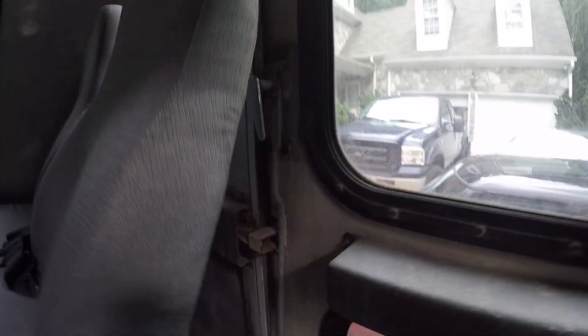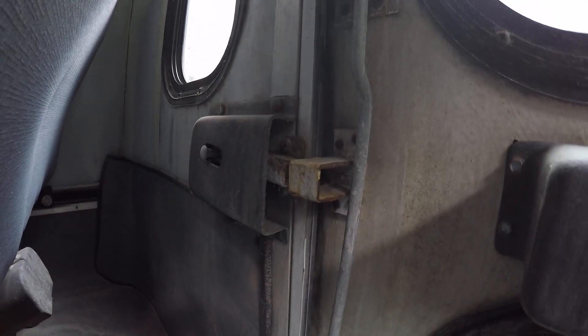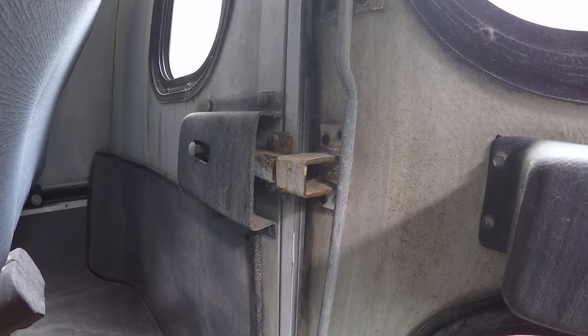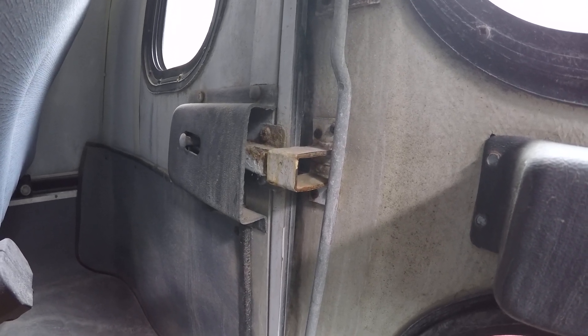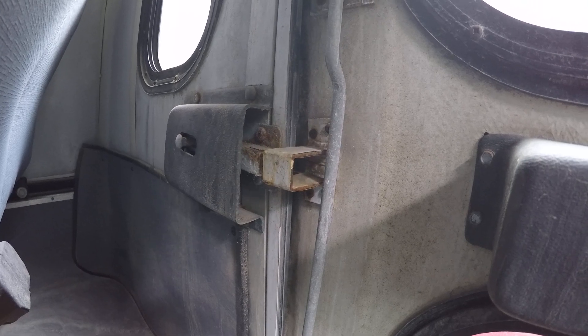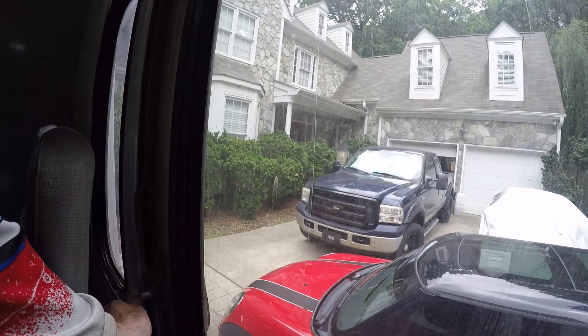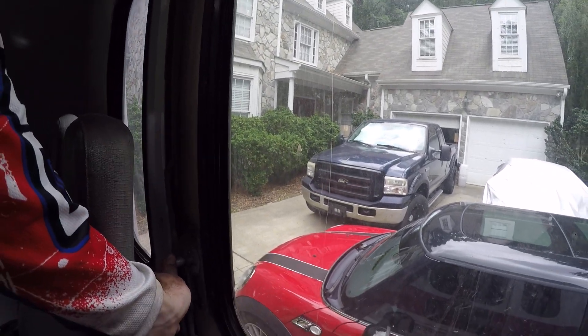Rear AC emergency door. Most emergency doors also have a lock — you can see a lock right there. You can't start the bus with that lock engaged, so if you do, you're going to have an alarm. Really poor design — it's the same design as the ambulances, and it's just a poor design for locking a rear door, and these rust out.